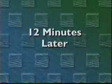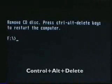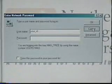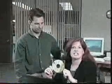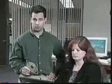This will take approximately 12 minutes. Once the imaging process is complete, remove the CD, then again press Control, Alt, and Delete all at the same time. The computer will restart and a new screen will appear. If you get an Error 38 message, left-click OK. The screen 'Enter Network Password' will open — left-click Cancel. This process only needs to be performed once, but do hang on to the CD in case you ever need to reload the software. Note that the Restore CD is custom designed for the 1300i NMU and isn't to be used on other computers — to do so is a violation of the lease agreement and could damage another computer.